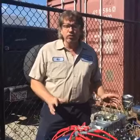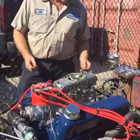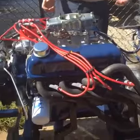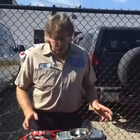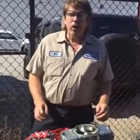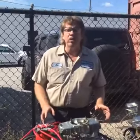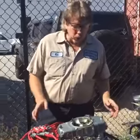It's not even a stroker motor, and it's nothing like what we do here today, and this thing sounds fantastic. It's a cast crank 302 Ford motor with ARP rod bolts. We balanced it, we bored it, we deck plate honed it. The line bore was checked. The camshaft is a 268 Comp cam that we degreed in. The cylinder heads got a 3-angle valve job. The very first thing we do on every single engine before we build it is pressure test it and magnaflux it, and we do the same with the cylinder heads to make sure that the core is good. Once all that was done, the whole full rebuild went on.